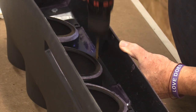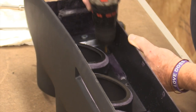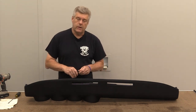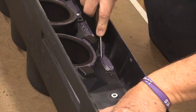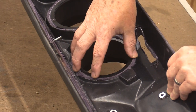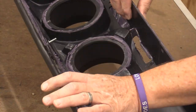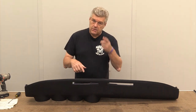Drilling all four of these out — lightly, don't put a lot of pressure on it because you don't want to pop the front-facing vinyl off of the backing plate. Now I'm going to use my pocket knife — you can use a utility knife or whatever — to open these up. I don't want to use a ton of pressure to go through the plastic or the vinyl. One thing I will point out while doing this on the back: when you look at this piece here, you're going to have to center your clock or your blank because there are no ways to put the original-style clip setups on this mounting position. So that is something that's a little bit different — you're going to have to kind of worry it into place.